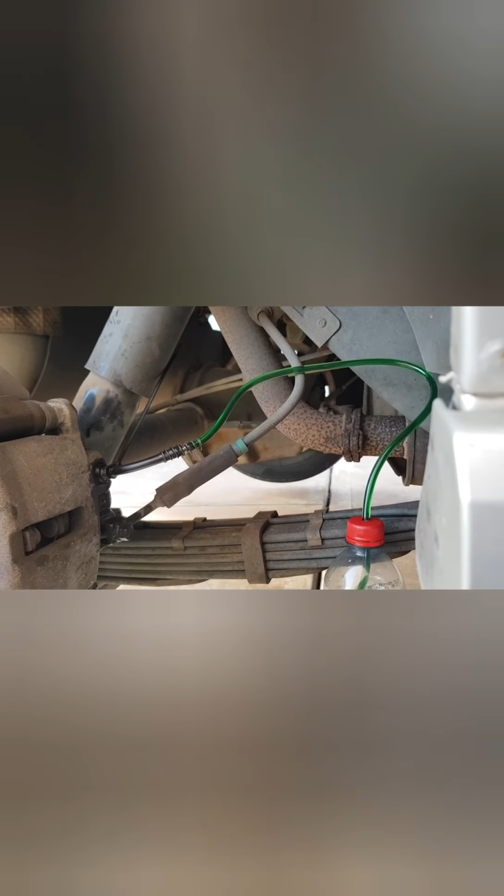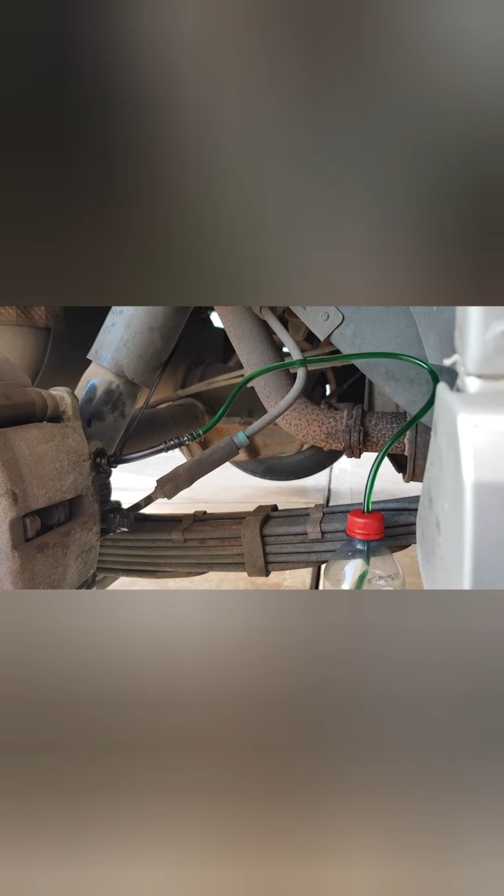What we want to do is continue checking the brake fluid reservoir and topping up, making sure the level is high enough. We don't want to forget about that reservoir and then suck air into the system if the fluid flushes out. But we'll return here once the fluid is coming out fresh and clean, like the brand new fluid coming out of the new bottle. So guys, I'll be right with you again once things are looking a bit more flushed.